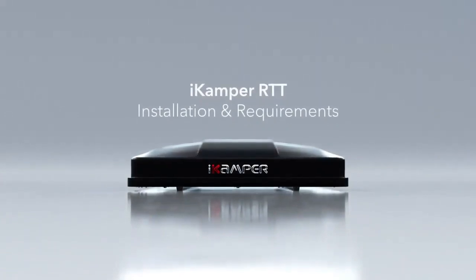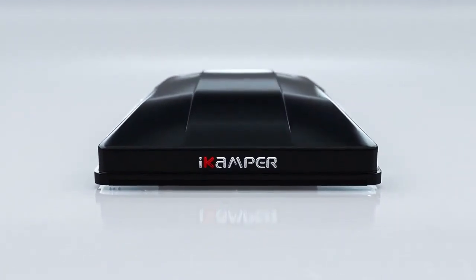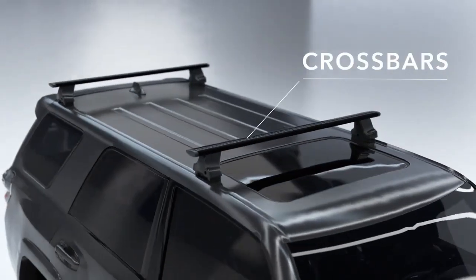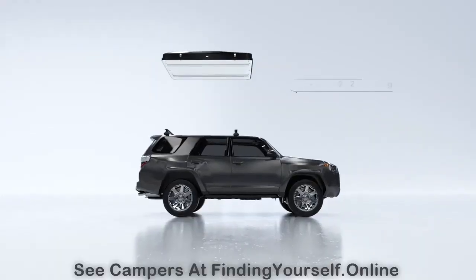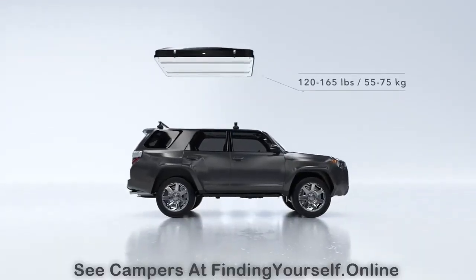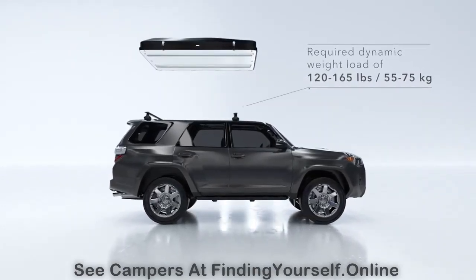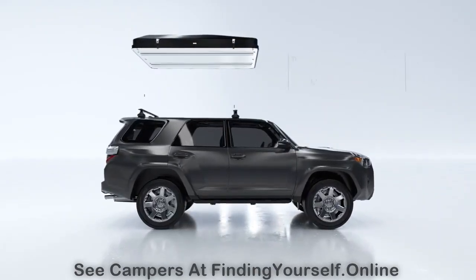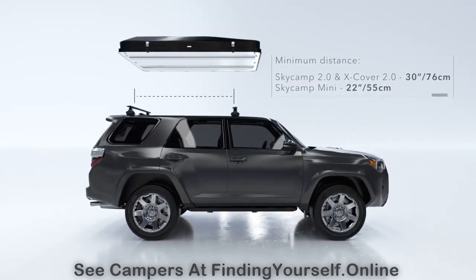The installation of an iKamper rooftop tent is simple and straightforward. Your vehicle should have crossbars or a roof rack. An iKamper RTT weighs 120 to 165 pounds, so you need a system that can support it. Space your crossbars enough to distribute the weight of the tent and its occupants.